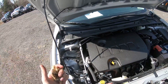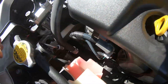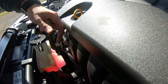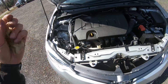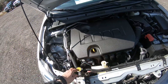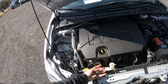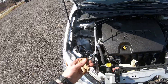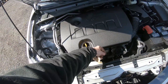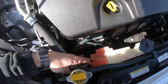Next thing in this car is coolant. Here is the coolant reservoir — it has a full sign right here. This is low, this is full; it should be somewhere in the middle always. Never open this when the car is hot. If you open either the radiator cap or even the reservoir, you might get boiling antifreeze in your face, which will lead to injuries. When the car is cold, no problem — check it out.